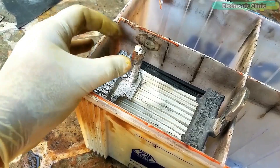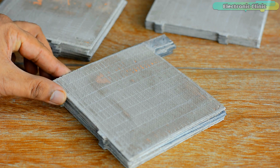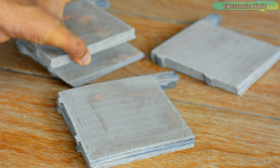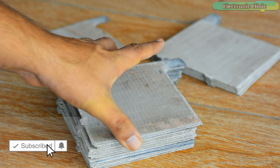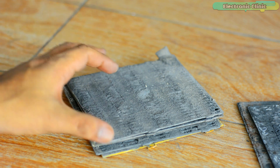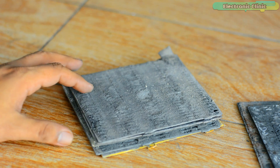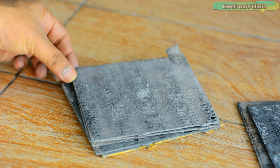When it comes to positive plate selection, I highly recommend purchasing good quality cells or plates. These are a little bit expensive but they tremendously increase the battery lifetime and performance. For a car battery you will need 24 positive plates. You can reuse salvage ground plates or purchase new ones — I will be using these salvage ground plates.